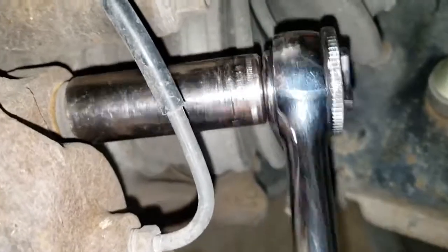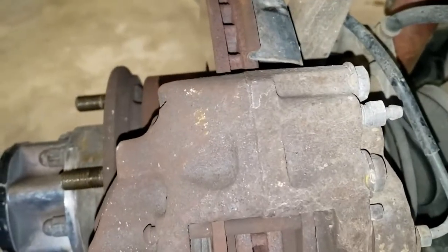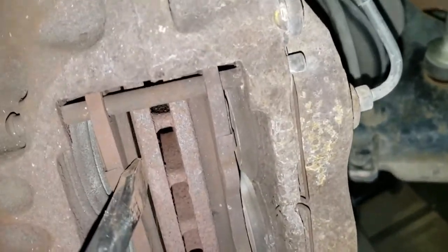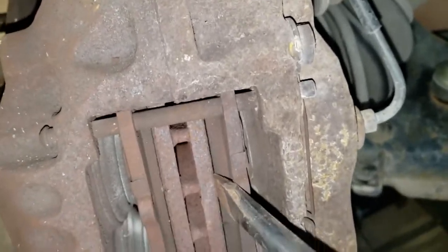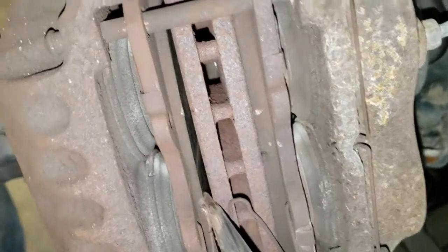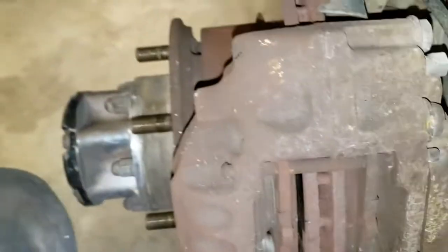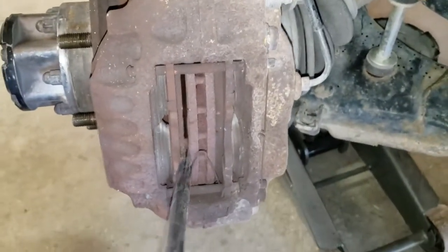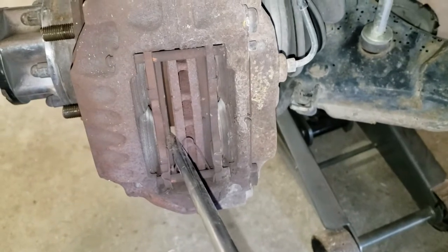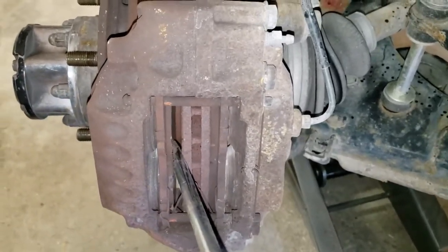Here's a step that people probably won't agree with, but get the camera back in focus — gently, you don't want to damage your rotor. Gently pry just a little; see how it gives that little play right there. Work your screwdriver in there because you have to slowly compress — you're tearing those old brake pads up but it doesn't matter, they're going in the recycle. You've got to do it slow and easy; you don't want to hurt your rotor. Just slowly work your screwdriver, compressing those two pistons, pushing your fluid back.